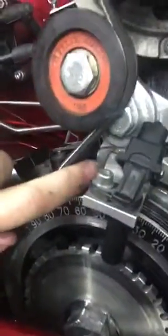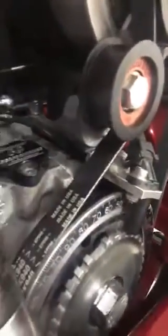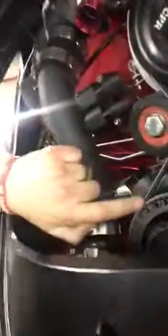So what we're going to do is install that spacer kit, because if you look very carefully right in here, what they've done is they've just used some standard washers to space the crank position sensor out. If they get any closer it would hit the pulley right here, so we're going to install the spacer kit with the longer bolt. They also give you a longer bolt for the spacer to make everything line up and match better.